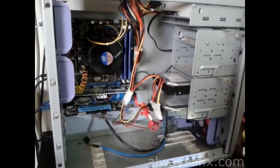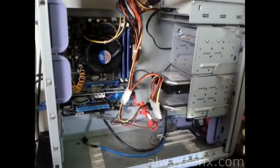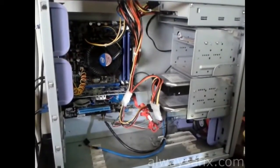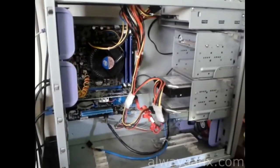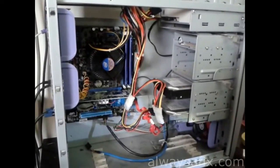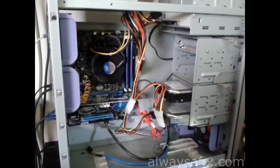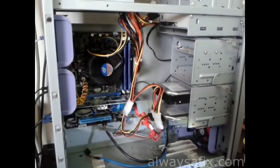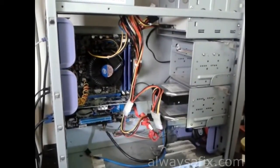We've installed the motherboard, the RAM, and the graphics card, replaced the power supply, and the DVD-RW. We're just installing Windows 7 now — everything has gone together very well. For about 180 euros we've been able to do this upgrade, which is a significant upgrade from a Pentium 4 with DDR1. This PC from now on will be able to play all the basic new games and you shouldn't have any problems as far as Windows 7 and Windows 8 go.